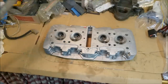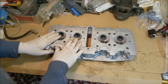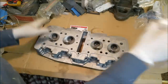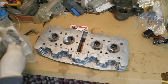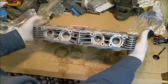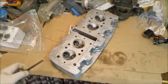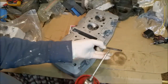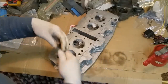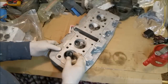After that we need to check the guides — these things are notorious for guide wear, particularly on the exhaust. I've got the valves here and I'm going to lap them in. I'll stick a bit of oil on there. It just goes against me not putting oil on a guide and sliding the stem in — and that is tight as a fish's bottom.